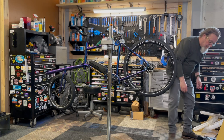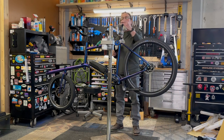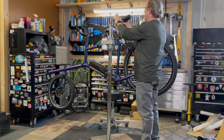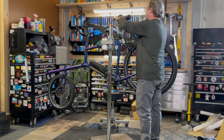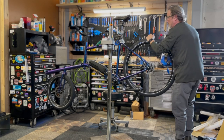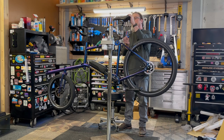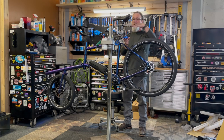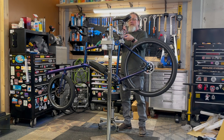Yeah, where's that saddle? It's made by Velo, like a lot of saddles out there. It makes the fore-aft adjustment separate from the angle of the seat. Snug, not tight yet. And if you're having trouble with uncomfortableness on your ride, you might just putz with the tilt of the saddle. Even just a millimeter or less can make a huge difference depending on how your body likes to sit on a saddle.